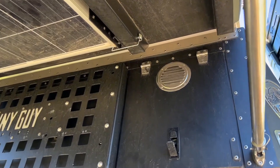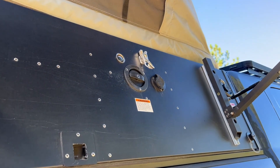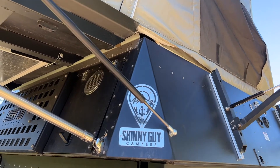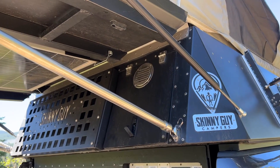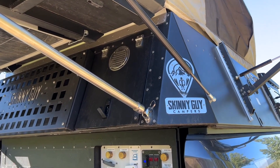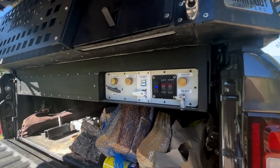Talking capacities on this camper: we have a 190-watt solar panel, a 34-gallon fresh water tank, about four or five gallons in the hot water heater as well, and a 100 amp-hour battery. At 8.33 pounds per gallon, you can easily end up with 350 to 400 pounds of water in this camper, so you need to be mindful of your payload. It comes in at around 1,200 to 1,300 pounds wet, so you need to make sure your truck can take that load — and that it can take that load up fairly high on the chassis as well.